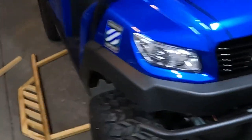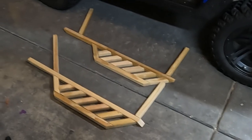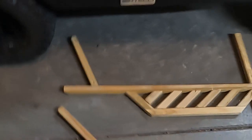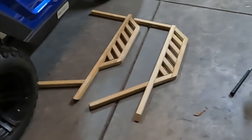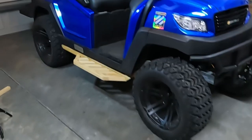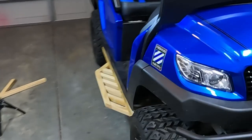Now for that sweet bonus material. I was looking all over for some rock sliders or step rails or something to add to the side of this. What I did is I went ahead and mocked up using some two-by-twos — because those are one and a half inches, which is probably what I would use for any kind of step rail. I've got these two designs here with slightly different angles. I'm going to go ahead and throw one of these on just so you can see what it looks like. Eventually I'm going to get myself a welder and try welding for the first time, get some steel and build these things up. I went ahead and just threw them on real quick so you could see what the mockup would look like.